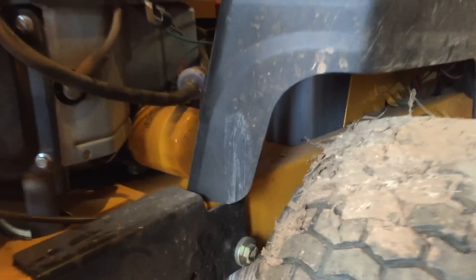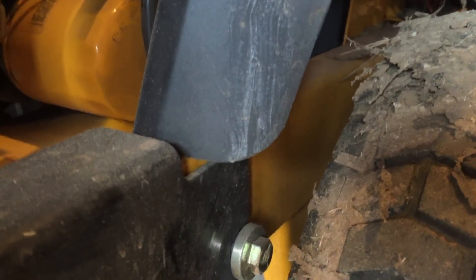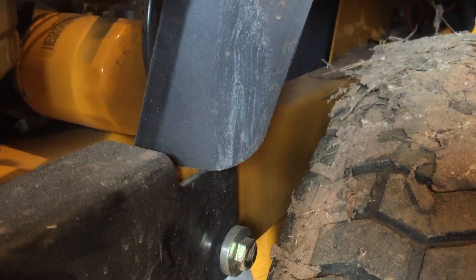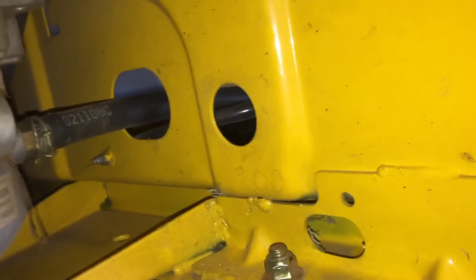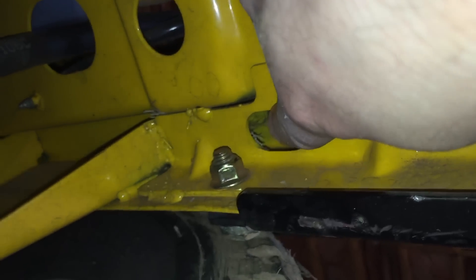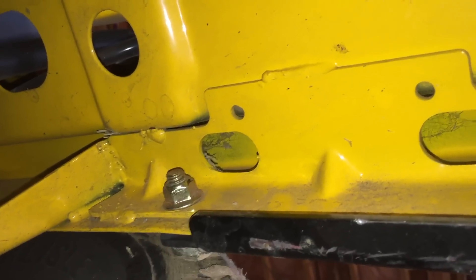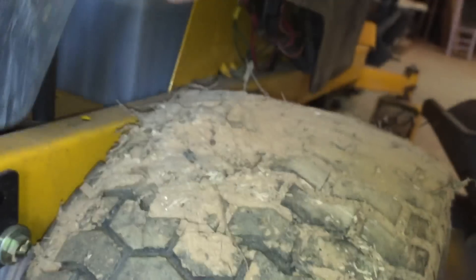After you take off the first three bolts, you have to remove the one that's under here. I'm going to try to avoid removing the one under the front corner up there — that would be how you remove the whole panel — but I have to remove this one so I can lift this panel up. If we look under the mower, it's under the second hole on the side — not this one, but the closest one to the tire. There's an 8-millimeter bolt in there that you pull out, and then the whole side will lift up.